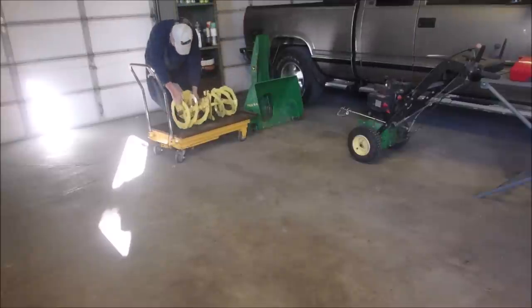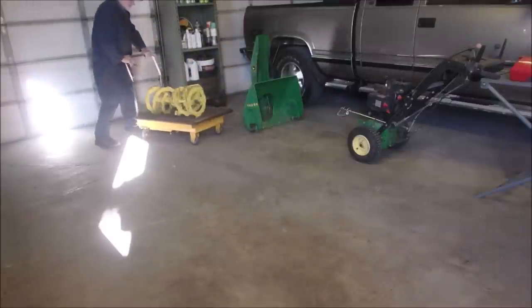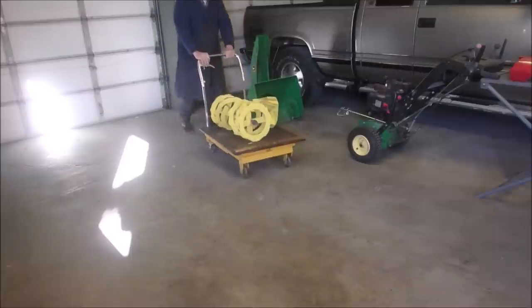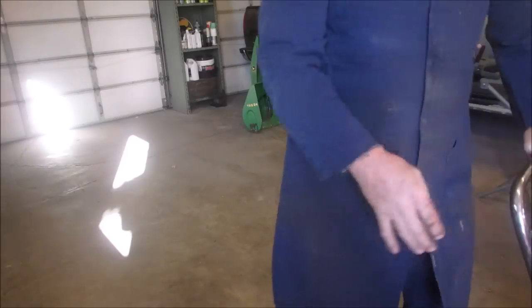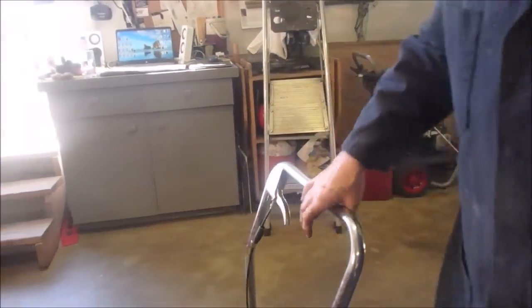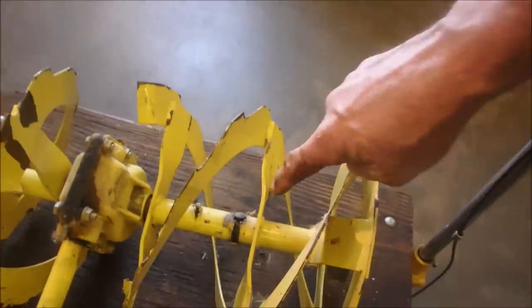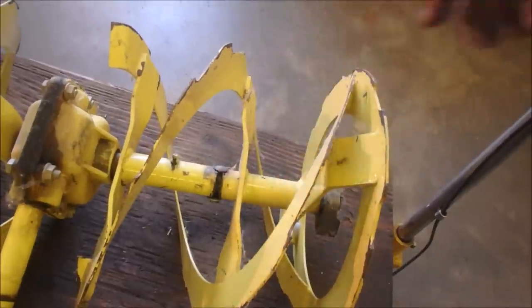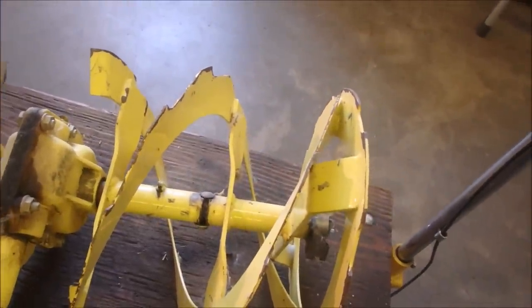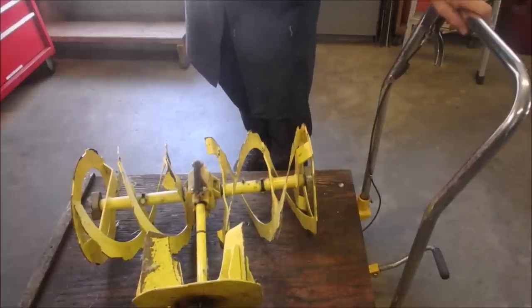Okay, we got problems. Wait, don't run. These kind of troubles are lots of fun. We got problems here, guys. How on earth am I gonna fix that? That bolt has rotated so far, it's cut the sleeve. That one's not too bad. I can bang that one back with a hammer and just touch it with a welder. So once again the owner never used shear bolts, eh?